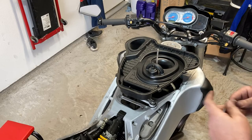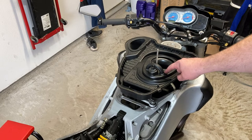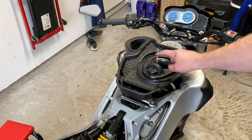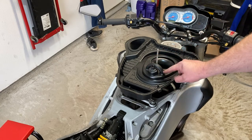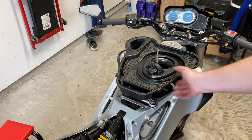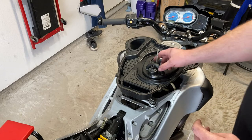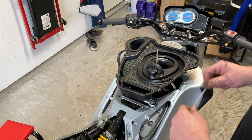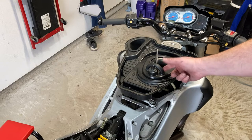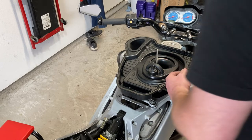We're getting really close, so I thought I'd share a couple things. One, this is what you have to plug off whenever you bypass the crankcase ventilation system away from the airbox. All that is, is a piece of vacuum hose shoved down in both of those holes. That's it. It's real straightforward. Plugs it up, all good, and it's airtight. It took some serious force to get that in, so it's not coming out anytime soon. You could probably use some epoxy to plug that up, but this is fine, and it's not obtrusive. It doesn't seem to affect anything in terms of performance.